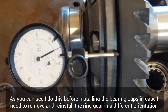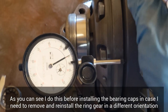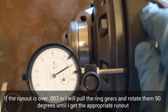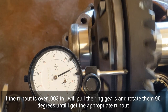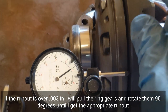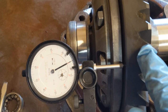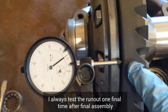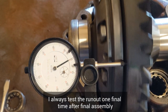I'm measuring the ring gear runout right now. Once I get it set to zero, I'm getting about 1 to maybe 1.5, almost 2 thousandths. It's such a sensitive device — a lot depends on which direction you're going or how fast you're moving it — but there's very little runout.